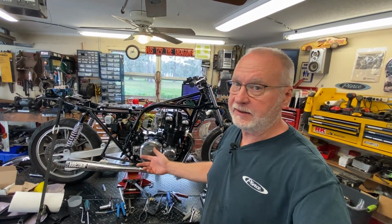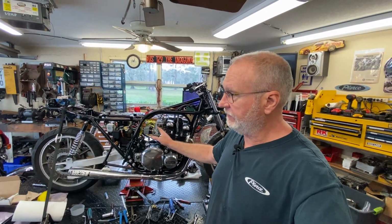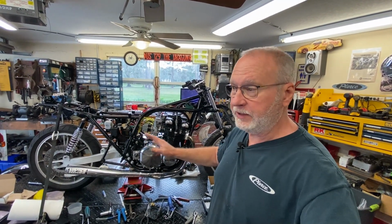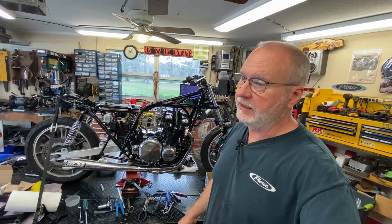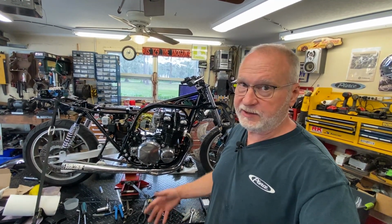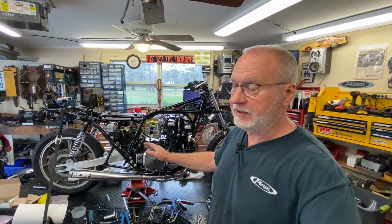I can't answer that. Things change because the engine has been built. Maybe it has higher airflow. When you have higher airflow in the intake charge with a larger jet, as I explained before, you're going to actually get a richer mixture. That's probably the case. A lot of times you have to drop your main jet down, and your slow jet to a degree, to a point that you wouldn't expect, you know, to expect a number to be that small. So the 117.5s in the mains may actually work pretty well in this scenario.